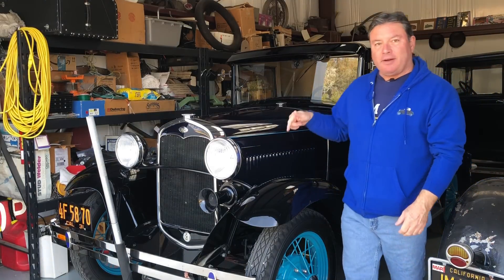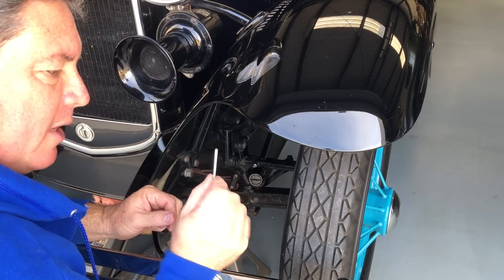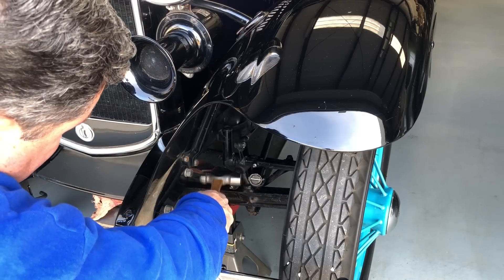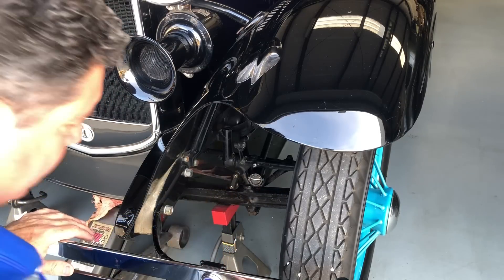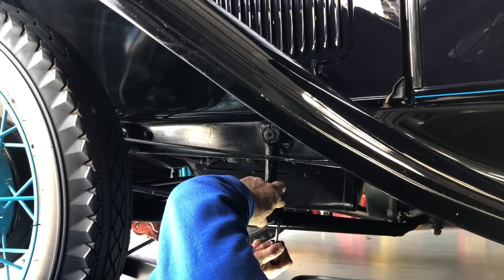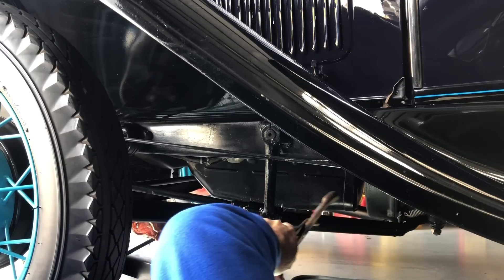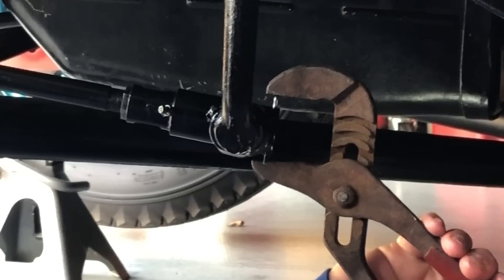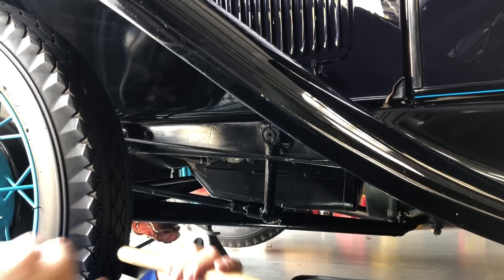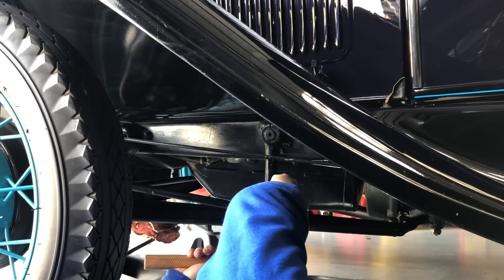It's a new morning. Let's put some cotter pins in this thing, get it down off the metallic cinder blocks and see if this thing's going to drive straight. We're finally at the part of the job where you get to put the cotter pins — that means job well done. Pro tip: if you want your cotter pins to always look shiny, spray them with a little bit of clear before you install them. If you want to split the end of a cotter pin easy, just stick a short blade screwdriver in there, then use your channel locks very gently, then finish it up with your hammer.